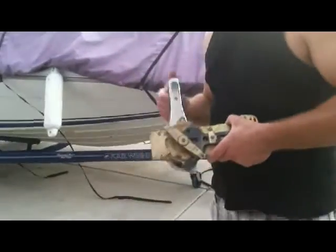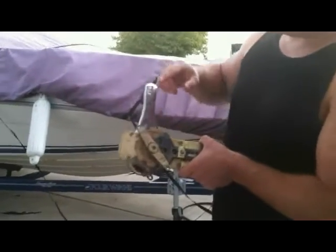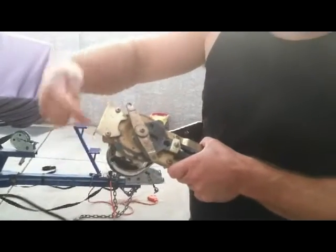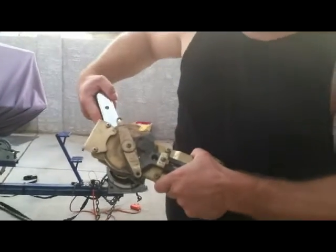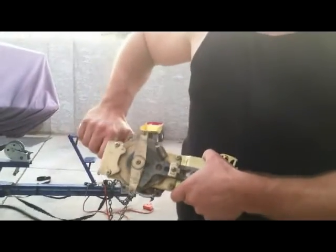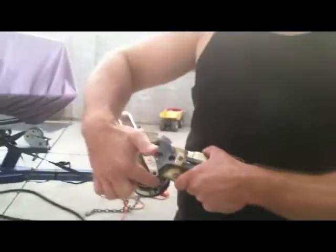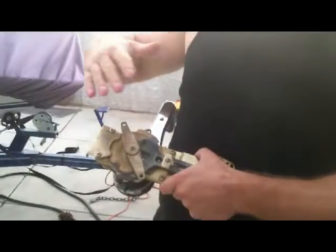Another step I've taken already, and I fully recommend — if not replacing it, just make sure you check your throttle. One of the things you'll have to do eventually is change the throw of the shift portion, which on this throttle are these arms here. You can see that if I go into reverse, this side pulls, this side pushes from neutral to reverse. From neutral to forward they go the opposite direction. This bar here operates the throttle — you can see how that corresponds with your throttle motion and opens and closes the butterflies of the carburetor, as opposed to these arms which operate the shift cable, the primary shift cable between the throttle and the shifter plate.